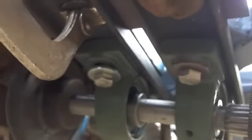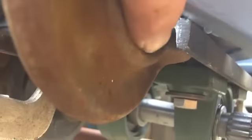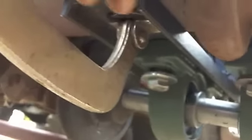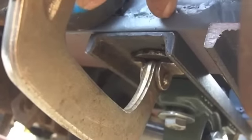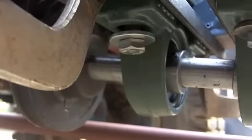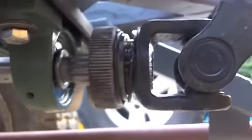So the two bearing carriers came in. You see I've got them on this shallow C channel, which is going to weld to those quarter inch plate feet that I have going there. There's the spline shaft that I built. The axle ended up cutting down to be about 11 inches. It looks like that's about a good length.